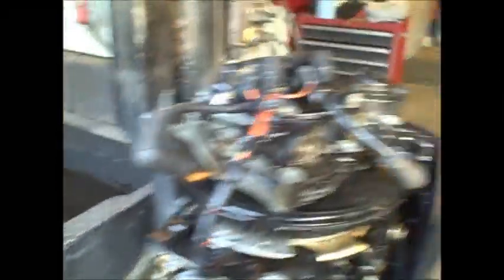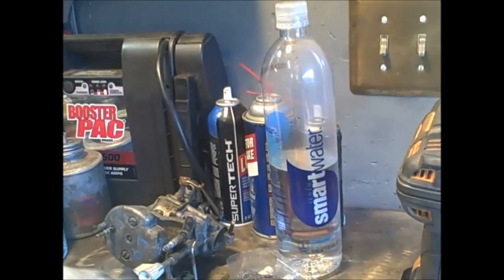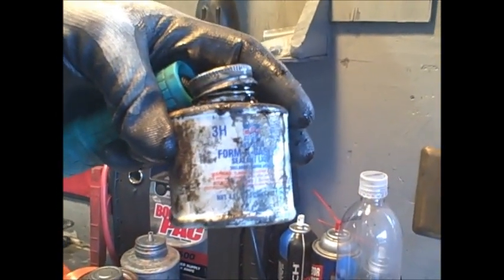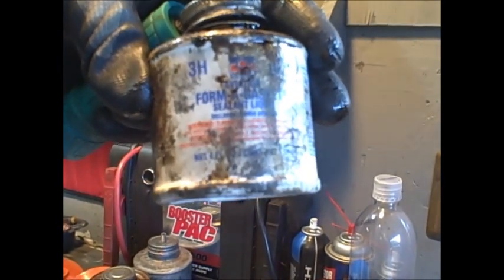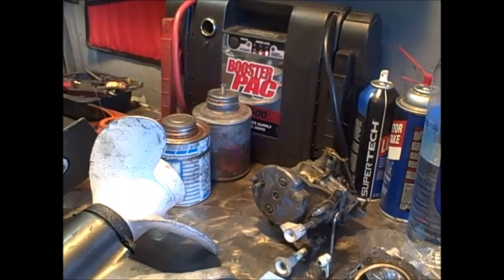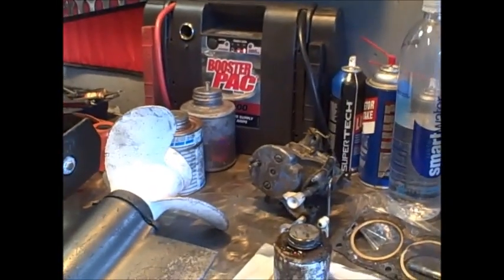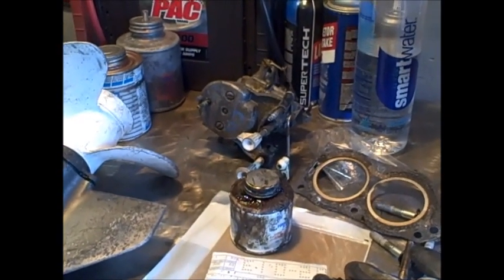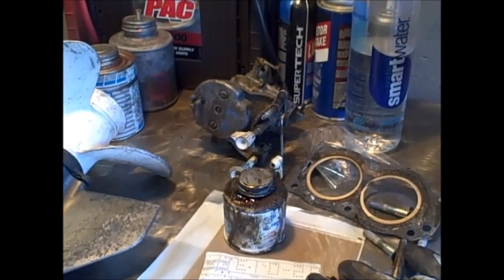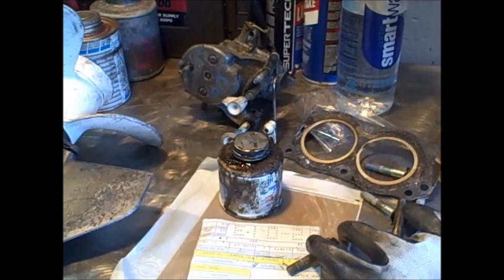I've got the head gasket just sitting there drying. What I like to do — some say it's not necessary — I use it on almost all gaskets. It's aviation formula gasket sealant liquid. I use it pretty much on most of my gaskets. Some head gaskets come with sealant already on them; this particular one did not. So I put a little bit on there. What I like to do is put a thin coating on both sides, then let it set for about 10-15 minutes until it gets really good and sticky. It helps me hold the gasket in place while I bolt the head back on. Anyway, I just wanted to show you that melted part there.